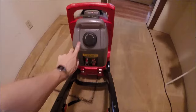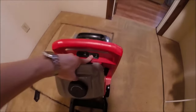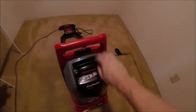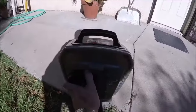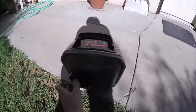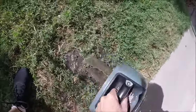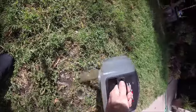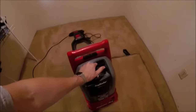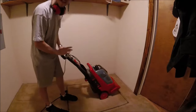Once you're out of solution, a little light will come on. Put the handle down, hold the right button — that's the clean tank release — then take it out and refill it. For the dirty bucket, hold this one right here to release it, then drain it too. Unscrew the back lid on the dirty one and pour out the solution — I pour it outside, but you could pour it down the toilet if needed. Then snap the dirty one back on and snap the clean one in.